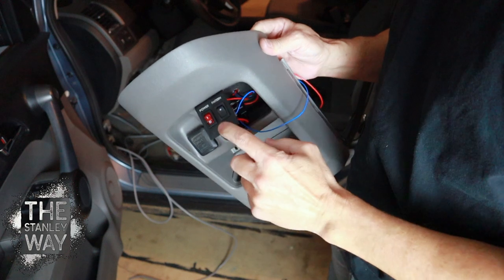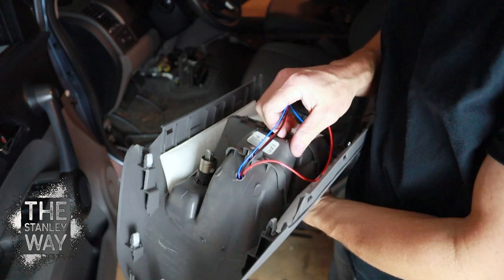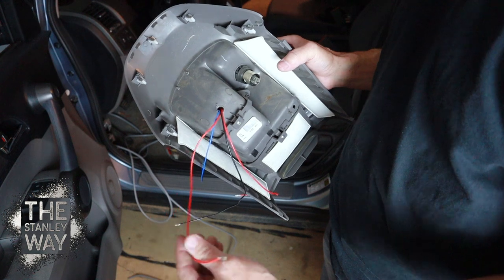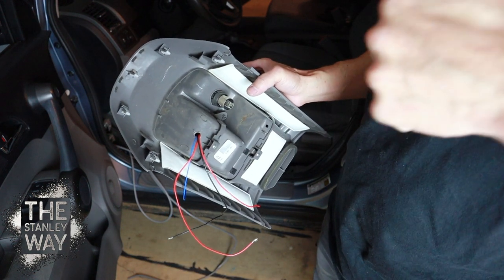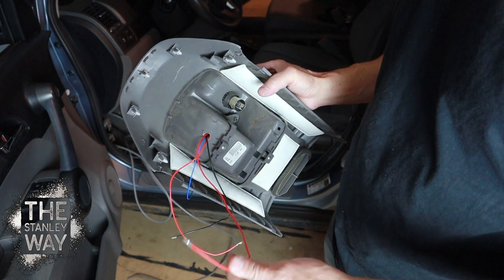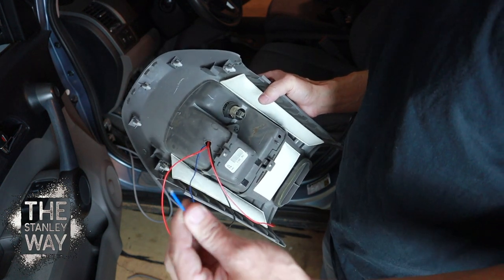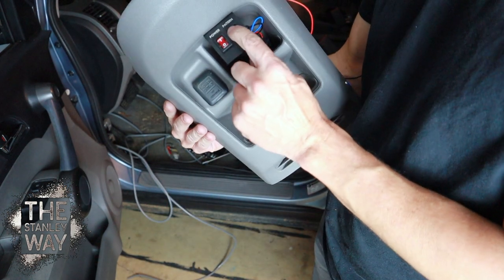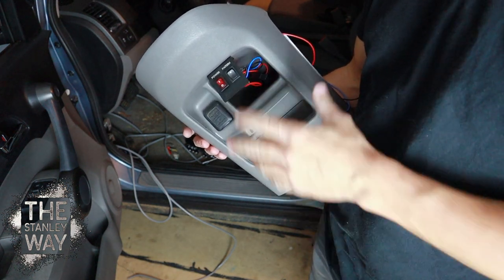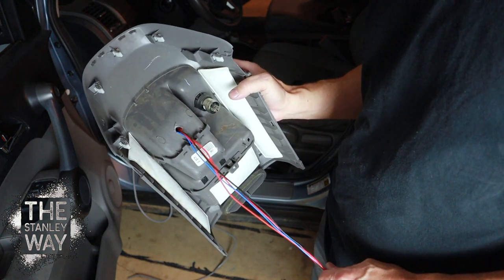What we've got at this point: our switch is mounted — this is the power switch, that's for the different patterns. There's a black wire going to ground, a red wire going all the way back to the lights, and a power wire going to 12 volts which I'll hook to the power supply right back here. There's also a blue wire — the remote wire — and whenever you hit the momentary switch that's what tells the flasher to change pattern. It all comes with full instructions; they also have instructional videos on their website.